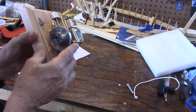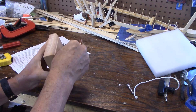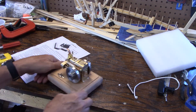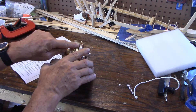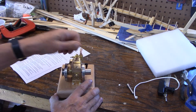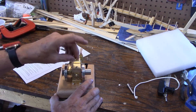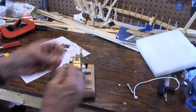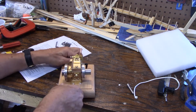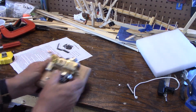You can see the pushrods here. There's a cover on the pushrods — that's the first thing I want to take off because I want to look at the rockers. And there's a really cool little fuel tank with a rubber gasket and a tiny, tiny hole in the middle. That's going to be easy to lose. And then it has a water jacket, so you squirt water in there to keep it cool.